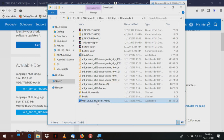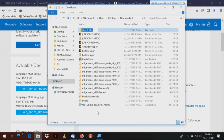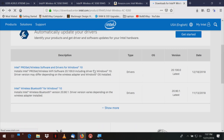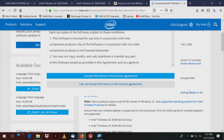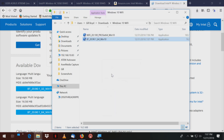I've downloaded those drivers and I'm going to put them somewhere easy to find. I'll create a directory called 'Windows 10 Wi-Fi' to keep track of everything. Call it whatever you like, but keep everything in one place. While I'm at it, I'll go ahead and download the Bluetooth drivers too — even though we don't need them right now, it's simpler. 64-bit only, which is what we want. Accept the EULA, save the file, cut it and paste it into the Windows 10 Wi-Fi folder.